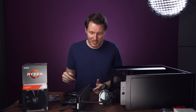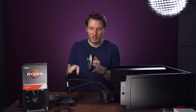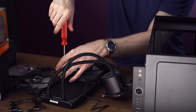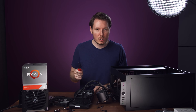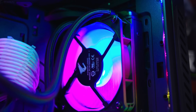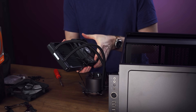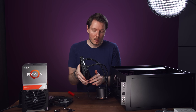I want the fans blowing into the case from the front, which is their uneven side. I really do feel like these fans were only meant to be installed the opposite way, but I checked the Aorus YouTube video for this product and they have one of their radiators installed on the front with the fans on the inside in this exact array. The fan is on and spinning fine — it's not rubbing against anything, so it seems like it should work. I'm just a little bit concerned about air leakage, but we'll see what the temps are like.